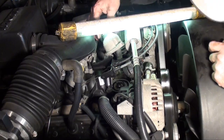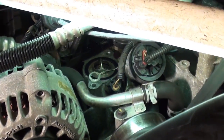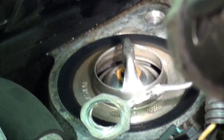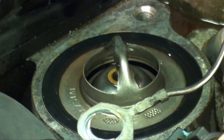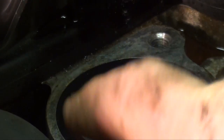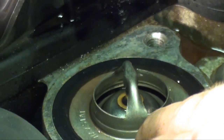The first thing I noticed when I removed that thermostat housing — I just want you to see it before I remove it in case it releases — if you noticed, it's open. So that was a pretty good educated guess. That thermostat is somewhere around 185-195 degrees and there's no way it should be open right now. I wouldn't be able to touch it at that temperature. I'm going to pop that thermostat out and put it on the bench so you guys can get a better look.